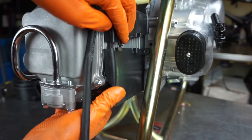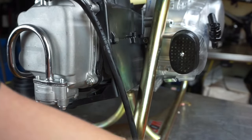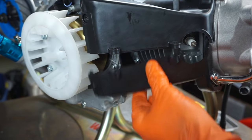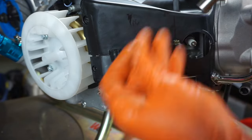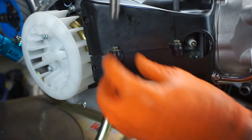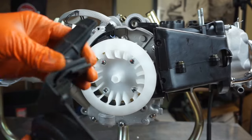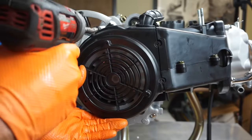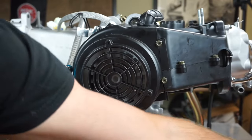You've got a little gasket for the valve cover — see that little lump? That lump goes right in line with the lump on the valve cover. Now install the top cooling shroud — make sure your gasket isn't holding it up. For the bottom cooling shroud, remember these little notches? They just clip into place. You have a screw up here. On the other side, get your screws in — be careful though, because these are plastic and you don't want to strip them. Make sure this piece is pushed in real nice and the little snorkel is in there, and install two 10mm nuts.